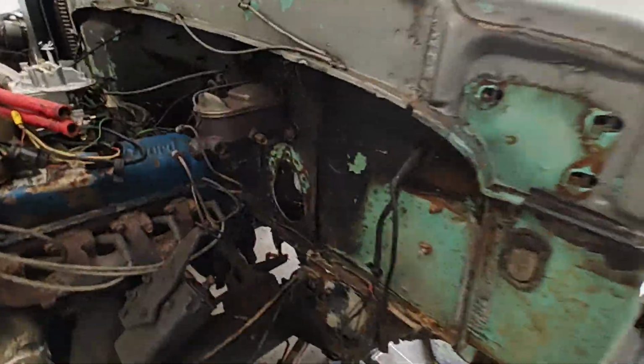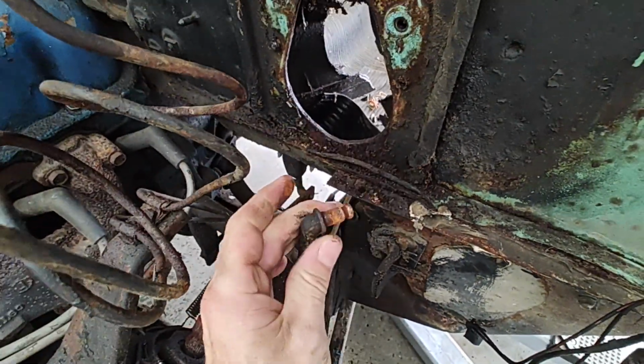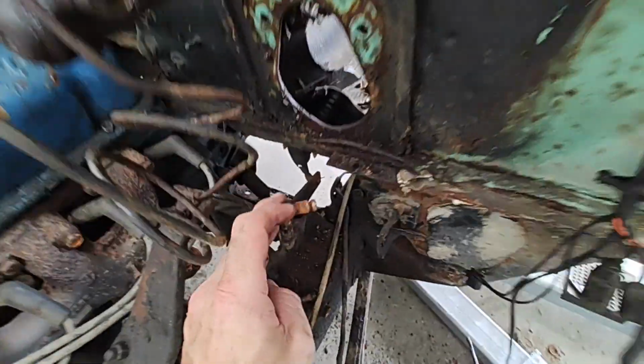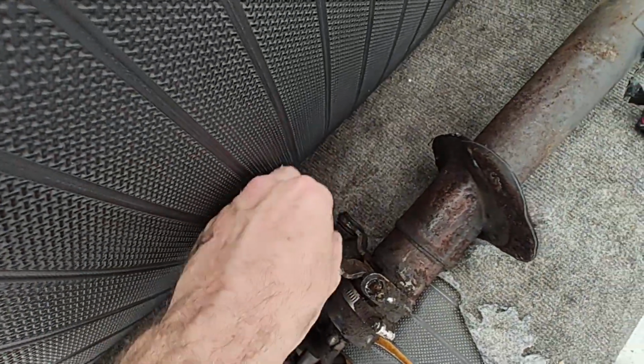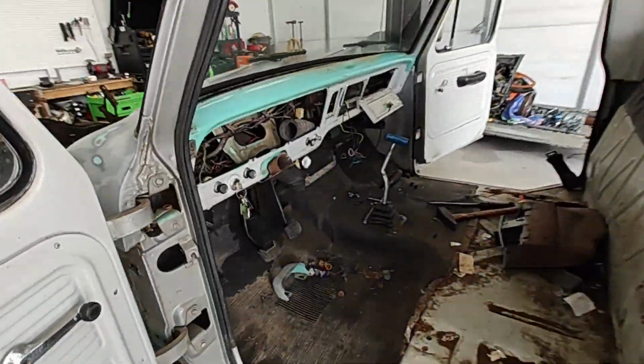If you've got the shifting linkages, they're just kind of hanging down there right now, but mine had the little, like this right here. This was up here for your shifting. This just slides in a bushing, and there's like a little clip. You can see it goes on right there. They go on right here, you know, for your little shifters. So you'll pull that clip out, pull that through. There's 2 of them. And then that son of a gun will come right on out.